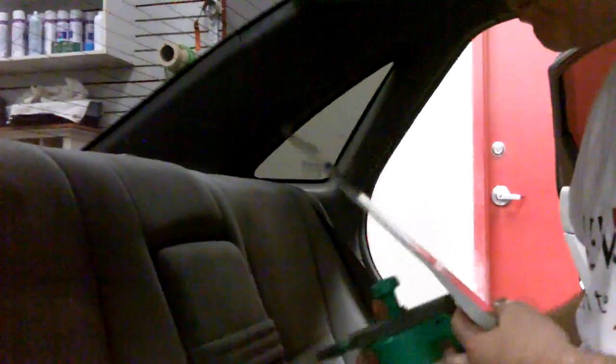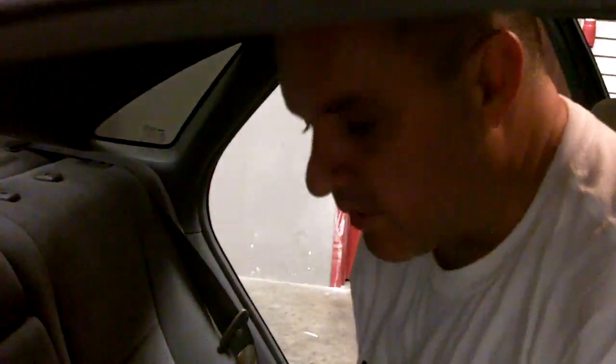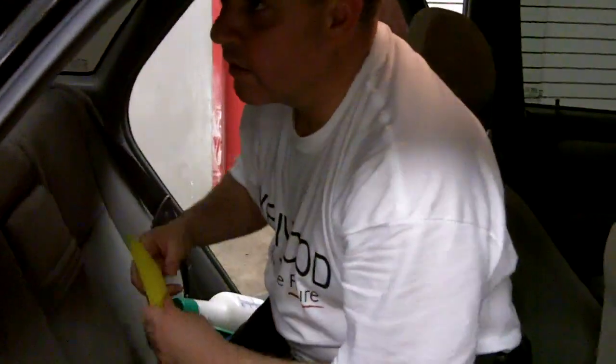Now I'm going to take my paddle and I'm going to squeegee behind the brake light, which I can't get to with my squeegee. It's really easy to do. Some people cut out around brake lights. It's really, to me, more trouble to cut out around one. Either you can remove them easily, or you can just tent behind them with these tools. And you don't have to, it looks better. It looks more professional. It's a lot easier, really quicker.